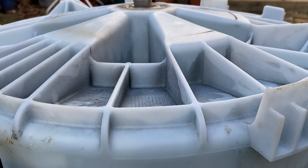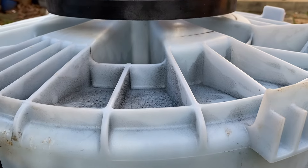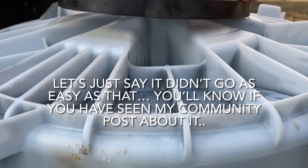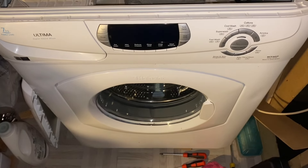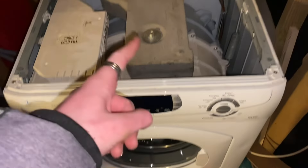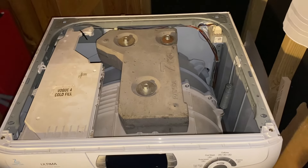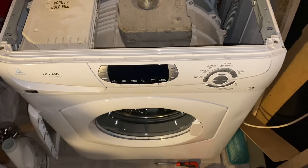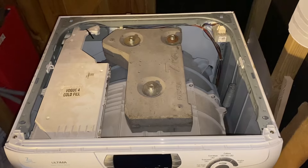I'm back - it's pretty dark outside now. Basically what happened was the shaft end, where the pulley sits, I had stoved it over by accident. So I had to file it down because it was a bit too big to fit on the pulley, and I had to re-thread where the screw goes into. I put a new screw in as well - just because I had to go to Halfords to get one. So it's finally back together now.